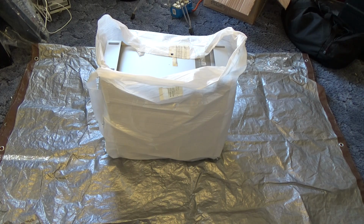About a week ago I tried to start it up. It would not start. The boot light on the power button would just blink. I found on the internet that that was a symptom of not enough RAM, or RAM not communicating properly. So that's when I took the side cover off and I saw all the mildew and the mold, and it stinks really bad. So I don't really know if it's got rust damage or anything like that, because like I said, I really haven't gotten into it really good.